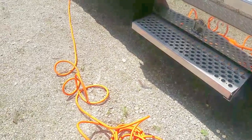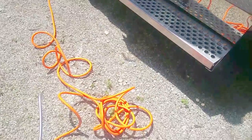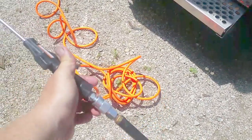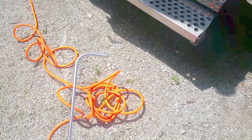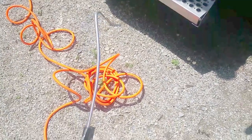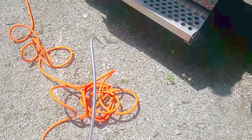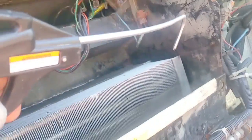One of these handy air lines hooked up to your brake glad hand — it's on the red side. The only thing I've done differently is I put a quick disconnect. They have this custom-made blow gun — it was straight; I picked this up at Menards last year. With a brake line pipe bender I put a nice 90-degree and an arc in it. Built this specifically for our Freightliner to clean out the coil. Now I'm just going to go in here and start cleaning this out. Ran the truck for just a little bit to build up some pressure.